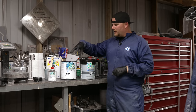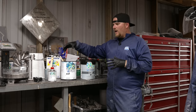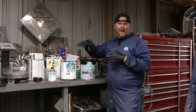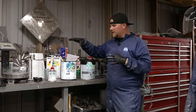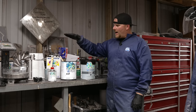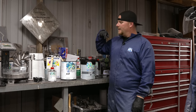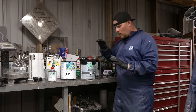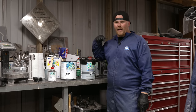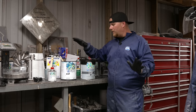If you have this reduced, okay, what we did after we have everything done is yesterday we sprayed the doors, the trunk, the hood, and some filler panels. I got as much stuff as I could spray because we've added reducer to that 3 gallon bucket, and now I need to get some of that out of the 3 gallon bucket so it'll fit back in the 2 gallons we started with, right? So spray all those parts. Once you're done, mix the bucket up thoroughly and then pour it back into the 2 gallons. Put notes on top of the bucket, already reduced, already sprayable, ready to go.